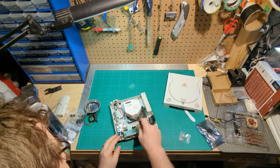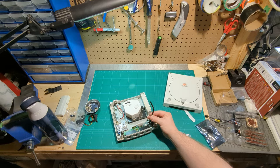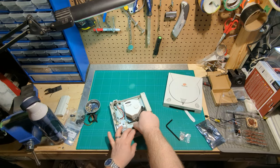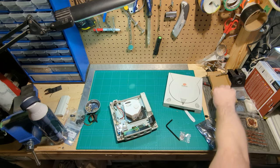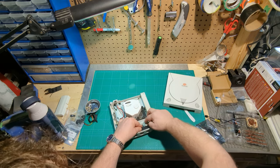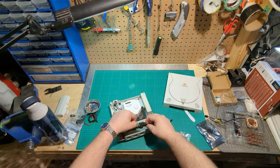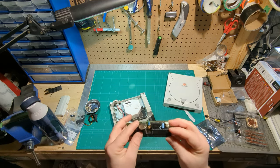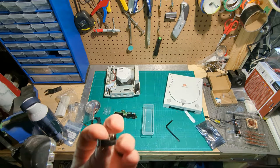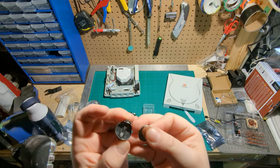The controller board's got to be off before I can solder things to it. Pull the ribbon cable out ever so gently, and now this tiny cord should come right out. My solution might be a little over-engineered, but I'd like a way for the battery to come in and out — a battery holder you can pop a battery into and replace again in the future if needed.